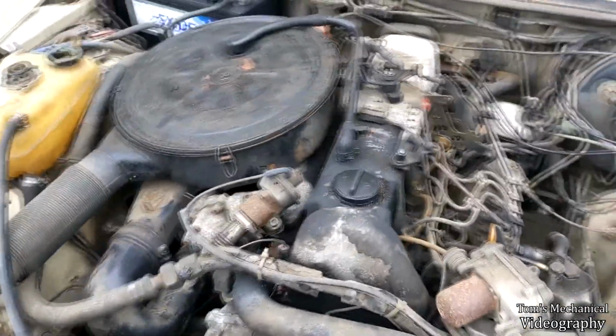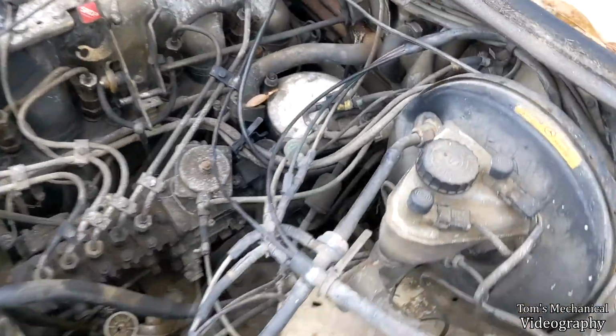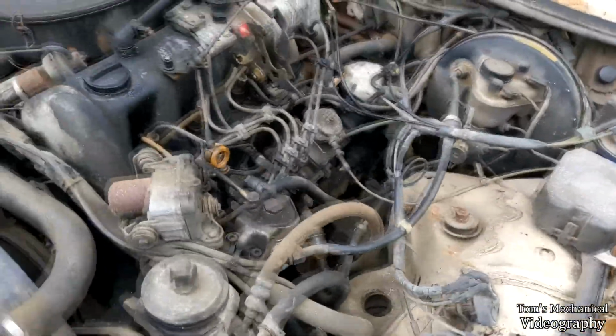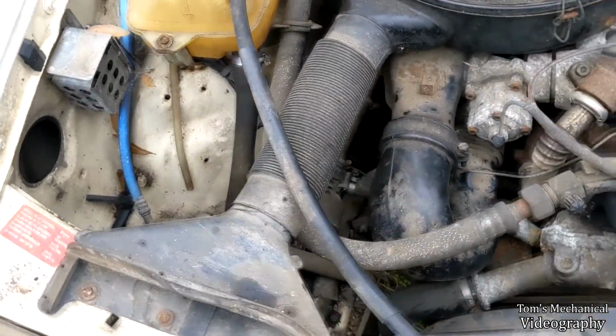So I'm confident that circuit's not working, but that is good to know, because now I know how to flush the heater cores. I need to take that line off, and I need to take that line off, which isn't going to be fun. So instead I'll take that line off. If I do that, I think I can flush the heater core, and I can also check to see if that pump works or not. I'm sure it's a fuse or something, because I've never heard it run, because I put on heat and no heat comes out.